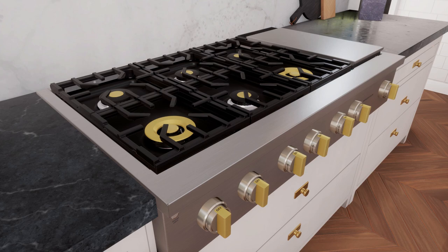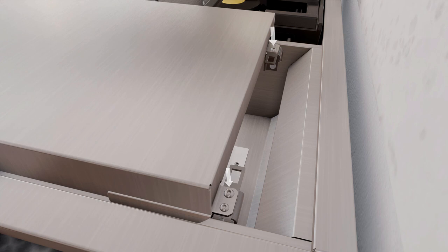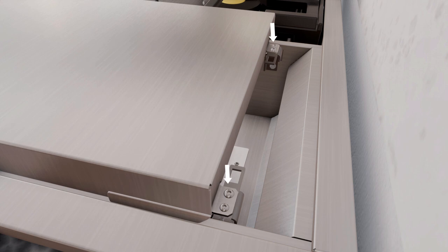To adjust and level the griddle, place the burner grates over the burners — the grates must be properly seated. Before leveling, loosen the two inner clamping screws located under the griddle rear flue cover. These screws must not be removed. Adjust the slope of the griddle with the two leveling screws under the rear flue cover. Then adjust the griddle for a forward slope using the two outer leveling screws, which also must not be removed. After leveling the griddle, hand-tighten the clamping screws, but do not over-tighten to avoid any damage.